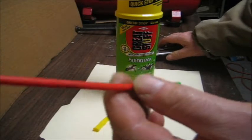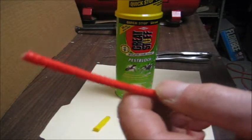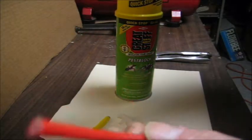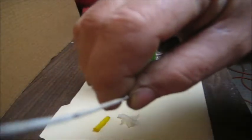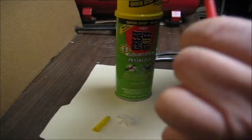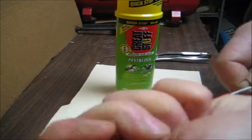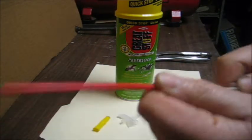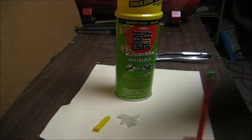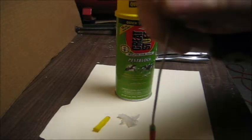On the old tubes, I would just use a sheetrock screw, and generally you would pull it right out. Then I got this coat hanger, and I just filed a little bit of a point on it to ream it through. Now right about here is where I'm having some difficulties, about a little better than halfway. So I'm poking it one way, then from the other side down.